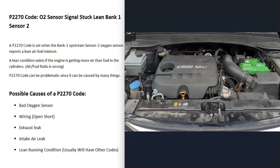The next possible cause is some kind of intake air leak or vacuum leak. All the air going into the engine should be going through the air intake box into the throttle body. If any air is getting into the engine around the throttle body — through a bad hose, bad gasket, or something similar — it can throw the sensors off and cause a lean running condition, meaning more air going into the cylinders than gas. Usually when that happens you'll get other codes as well, so be sure to pay attention to those.